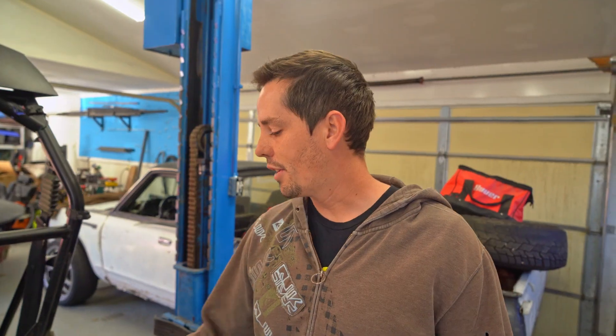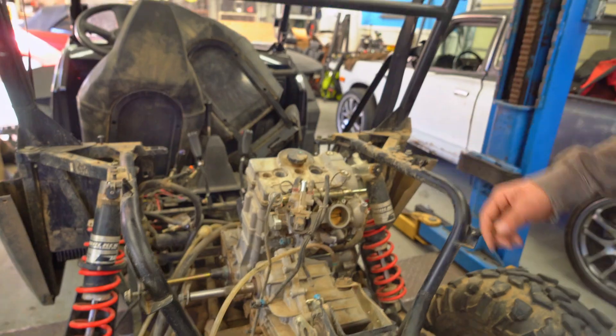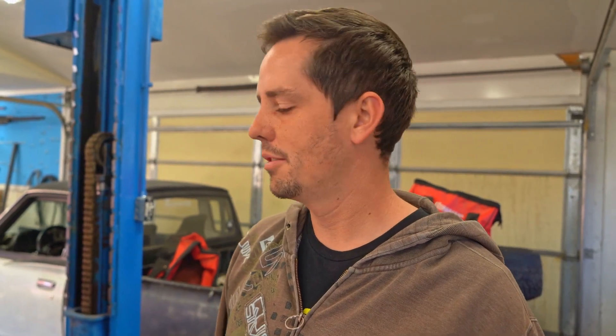The blown-up motor is 60 horsepower; the new electric motor is 120 — right around 100 kilowatts, about 200 foot-pounds of torque, so it should move pretty good. We're still deciding between two-wheel drive or four-wheel drive. As I was taking everything apart, there's a great setup for connecting into the existing transmission through a belt drive, just like the old motor did. The problem is, reading about this, the differentials and axles apparently blow up even when you just upgrade to a bigger 900cc motor, so I'm worried that doubling the power and tripling the torque will blow everything up. We might start with the electric transmission that comes with it — it's built for the torque we're putting out — and then add a separate electric motor in the front later.